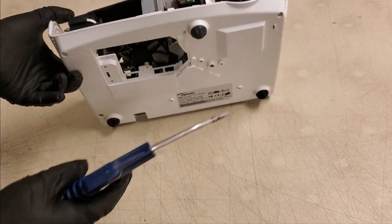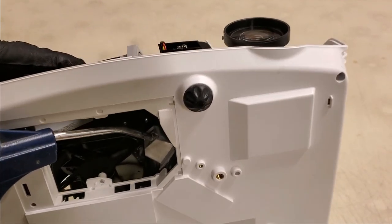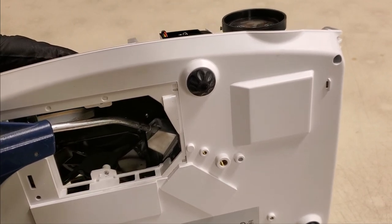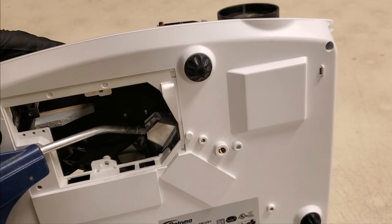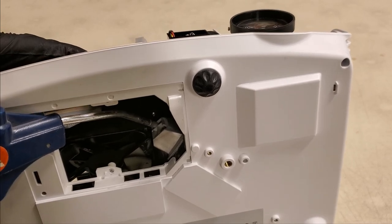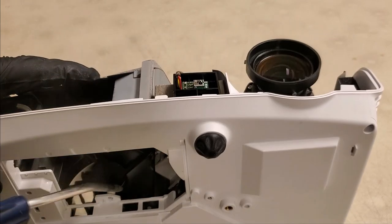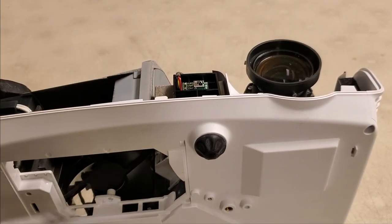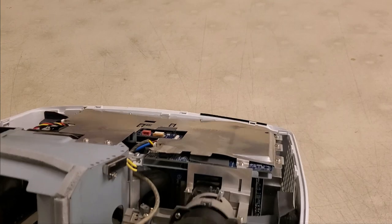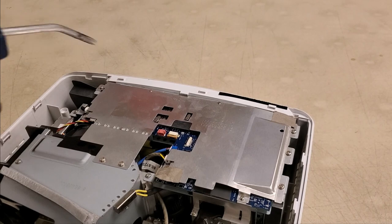And we want to get the fans. So we're going to get that blower fan. I'm going to put the nozzle actually into the vent. You can hear that fan. And that's the other reason I don't go above about 15 psi. If you make the fan spin too fast, it'll actually fly apart from centrifugal force. It's noisy, but that fan already looks a lot better, if you can see down in there. I'll zoom in once we get back to the bench.